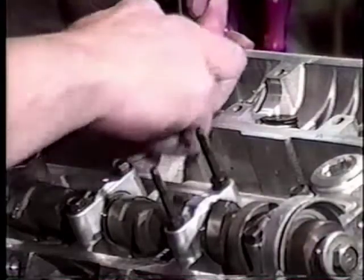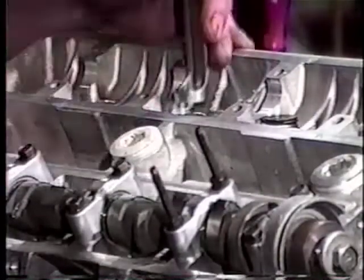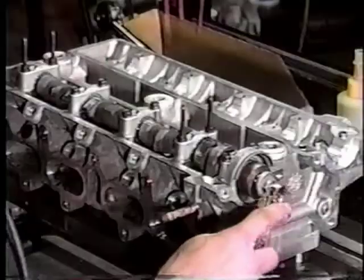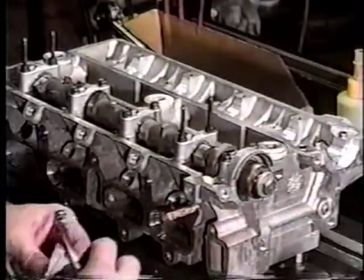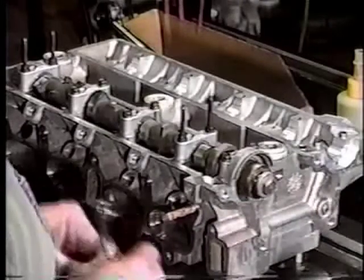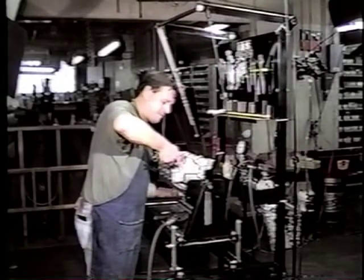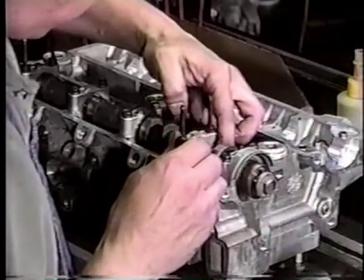Now we're onto a four-valve twin Toyota. What we're doing here is turning the lobe up on top center and putting a piece of cardboard — we all have the little boxes that seeds come in. Just fold those up and now you can spin it over. For doing correction on the puck, you're changing them without pulling the cam. You put the cardboard, spin it over backwards, and then come in and pop it out with a little magnet. You can change the pucks rather than have to pull the whole cam out.